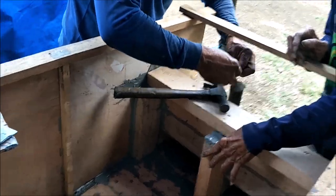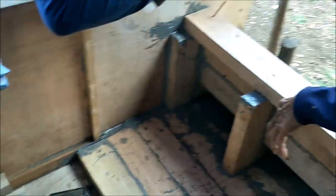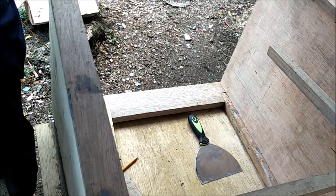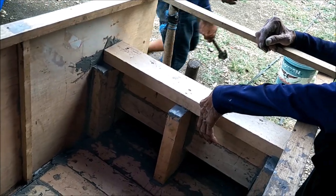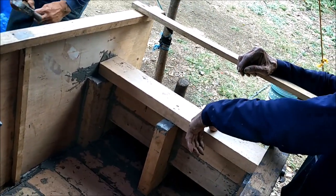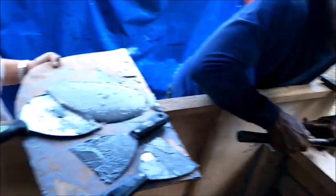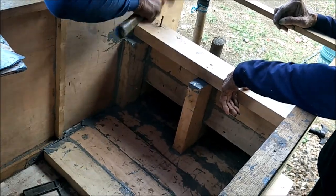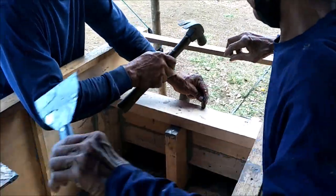We are putting in stairs at the back of the catamaran — you can see the stairs there even with the c-clamps and hammers. All the wood is already cut so we're well on our way. This one doesn't have stairs yet, just got the first little cross board at the bottom for support. Epoxy is everywhere, and you definitely want to epoxy everything because any little gap will let water seep into the edges of the wood and then you have a real mess.